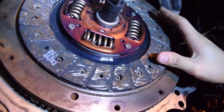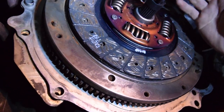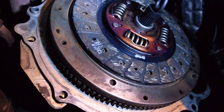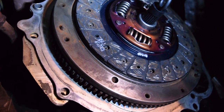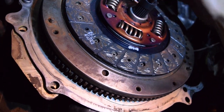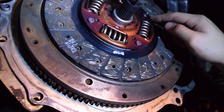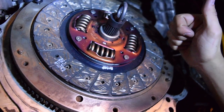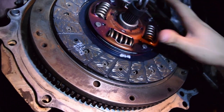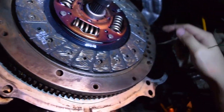Now we have our clutch here. You take the clutch and stick it onto the clutch alignment tool, which comes with the kit. Shove it into the pilot bearing — the clutch alignment tool goes into the pilot bearing and the clutch plate sticks onto it. It's very important to get the clutch flat and straight. The only other thing to remember is that the raised part of the clutch faces outward toward the transmission, not the engine — if you put it on upside down, it won't work.